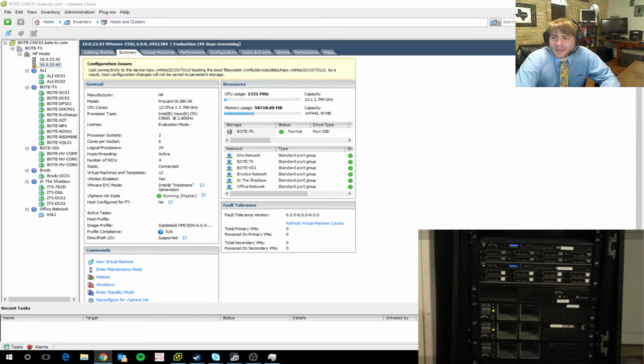I do want to get that hooked up to FreeNAS, so that way I'll have an additional 20 300 gig drives and an additional 4 2 terabyte. So that'll put me at a total of 12 2 terabyte drives in RAID 10 and 20 300 gig 15K drives in RAID 10. I know you're probably asking why everything RAID 10. I'm a big fan of the higher IOPS, faster speed and redundancy, and there's a 1-for-1 drive ratio. So that's my plan. I like to do it like that.